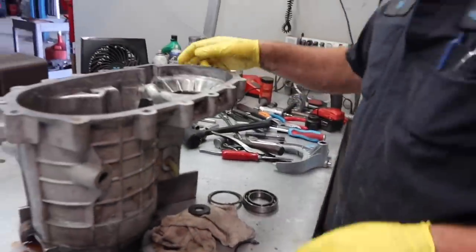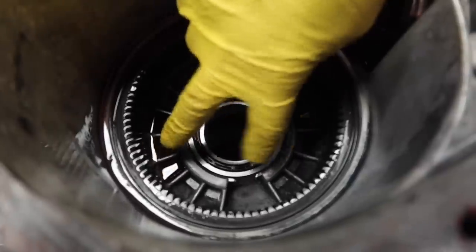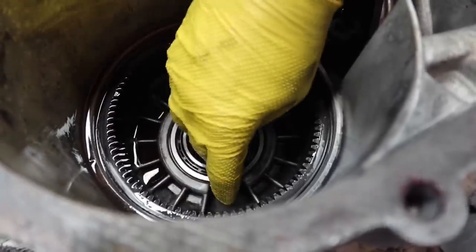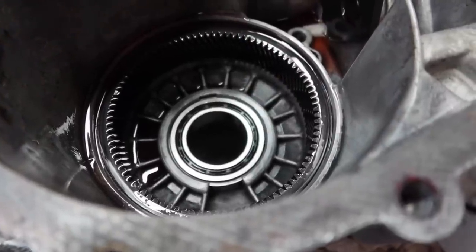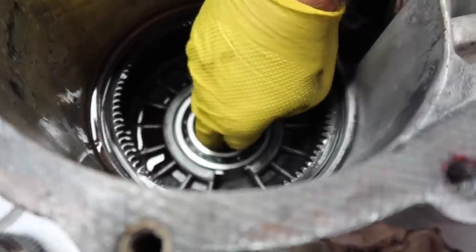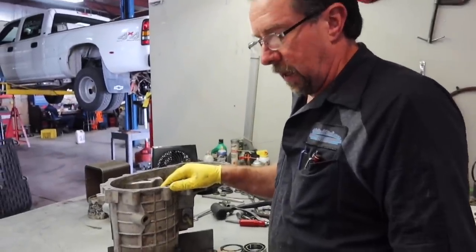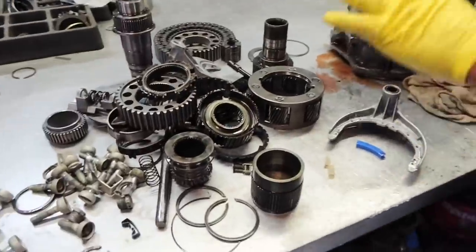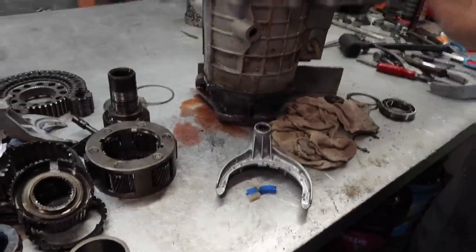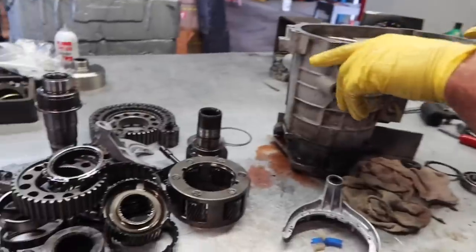Another issue with this case: whoever tore it apart initially overspread the snap ring. You can see the spread is too wide — it should be closed down further. When somebody just jams snap ring pliers on there and blasts it as wide as they can, you need to finesse this stuff when taking it apart. That snap ring is going to be junk too. Our slop on the bearing bore is not bad — this was probably a new front housing with a few new pieces. Not a horrible situation overall; we've got lots of usable parts. They just put some very questionable parts back in. We'll clean everything in the hot tank and inspect the chain for slop.